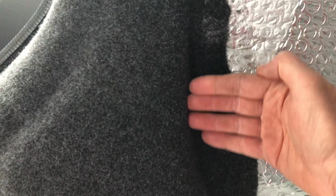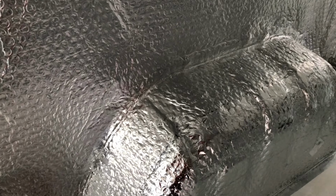the panel where the ply board will butt up. So effectively the ply board's going to butt up to here and around here, so you're not going to see any of this anyway. But like I said, I like to take it all the way in, because when you're looking from this side, you can actually see the carpet. So you want it finished off nicely. So that's the first part. Still got the wheel arch to do and around the doors, which I'm going to do now.